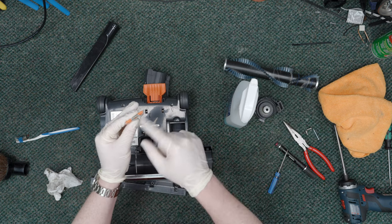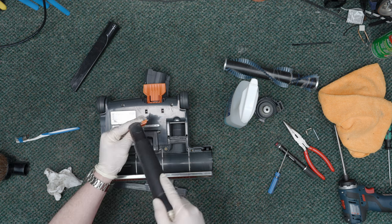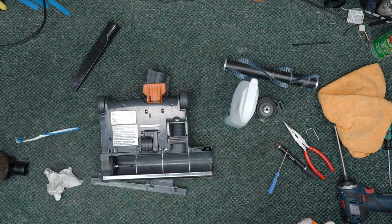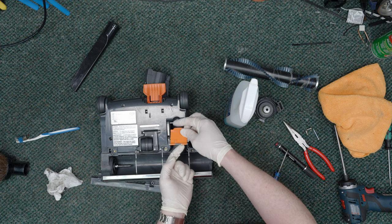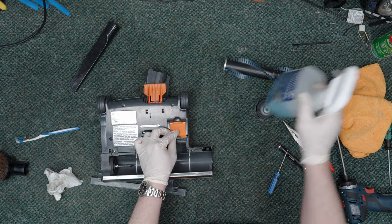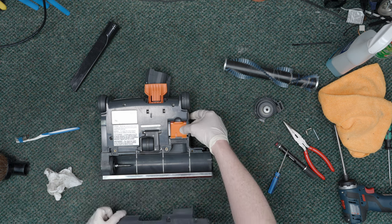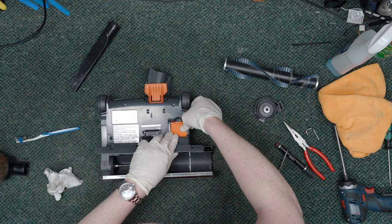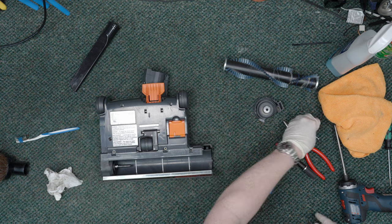This is captured captive by that spring, but I'm going to hold the spring with my finger and vacuum this off. To make sure this springs back, there is a little tab right here — I'm going to make sure that I put that in. The tab is right there. Now we're going to throw this on here — two little prongs go in first, just like that, and then it rotates down into place. This holds that captive, so we're going to go ahead and throw the screws on.